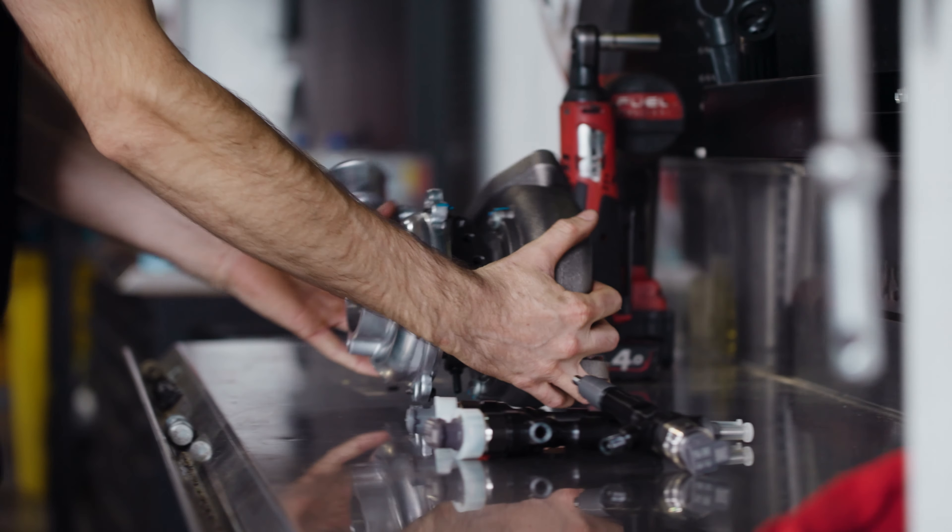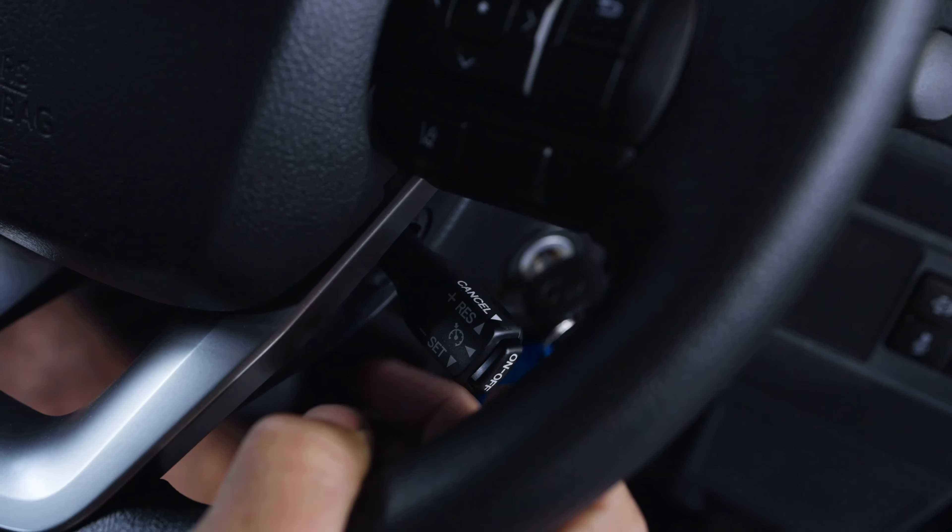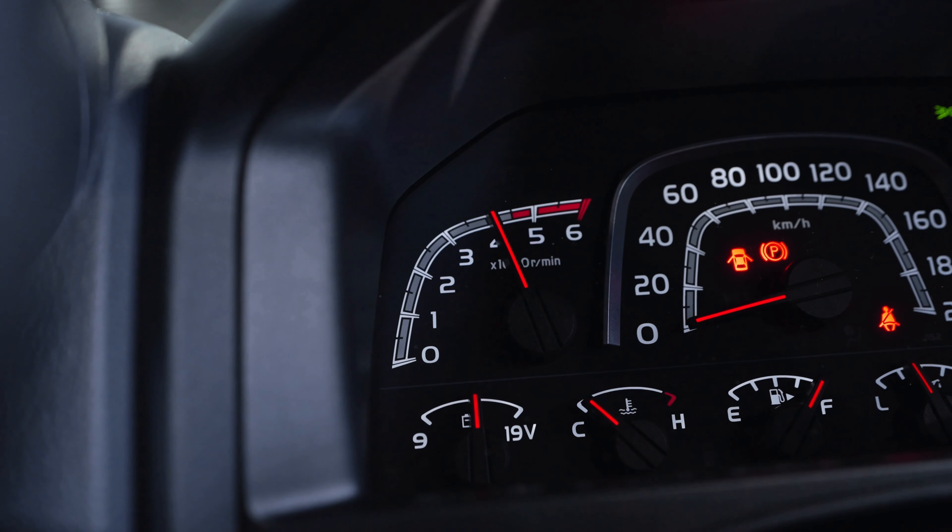Because it's got a turbo upgrade, it's really good to be able to switch the cruise control stalk down to go into a tow map. This allows us to run a lower boost pressure with a leaner AFR to get those temperatures in check. You also have the ability to drop it down into a stock map, which is lower power — if you don't want anyone to have as much power to drive the vehicle, it's definitely an option to have there.